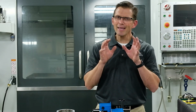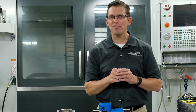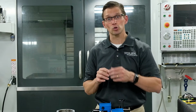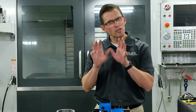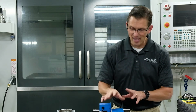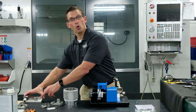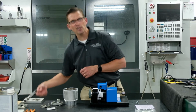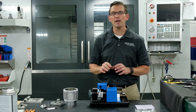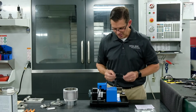The downside is you may get a little bit more blow-by, but we're not 100% convinced that's necessarily a bad thing, because that gas pressure that gets by the top ring can help the oil control ring do its job better. So a little extra ring end gap is not necessarily a bad thing. To create more ring end gap, that's where a ring filer comes into play. Many people have seen or used the old school manual hand grind tools. Today we have modern, more precise tools, like this power ring filer made by Total Seal.